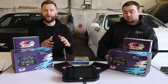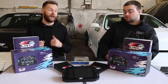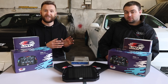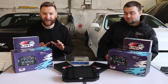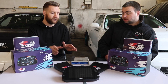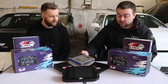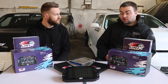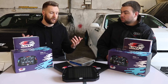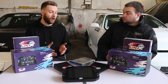So I guess the real question is, why do we need Link ECUs? What benefits do they give us over the traditional standard ECU that comes in a car? In mine, MoTeC ECU; and Pexi Power FC, same with Shane's. I brought Shane in here because he knows a hell of a lot more about this stuff than I do. So Shane, over a bog standard ECU, what would the benefits of an aftermarket ECU give you? Basically, with a standard ECU we're very limited in what can be changed in terms of parameters like fuel tables and ignition tables — they won't have boost control, and they're very limited in what you can monitor. So if you bolt on aftermarket parts like a turbo, exhaust, and intercooler and you have a standard ECU, you're very limited — you're not going to see the real benefits to those bolt-on performance parts unless you get an aftermarket ECU.